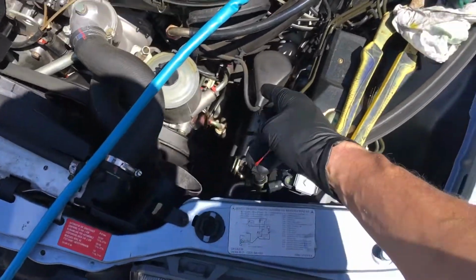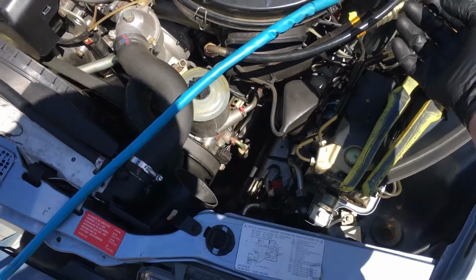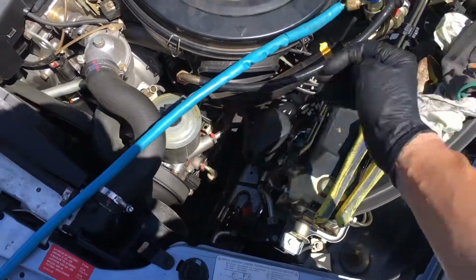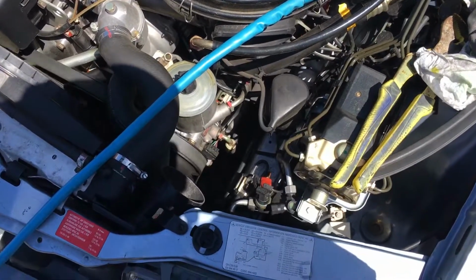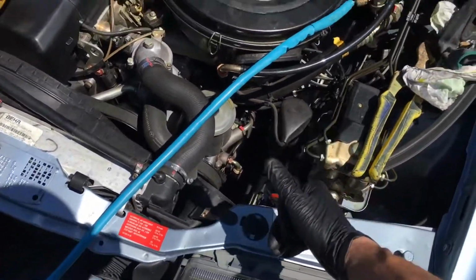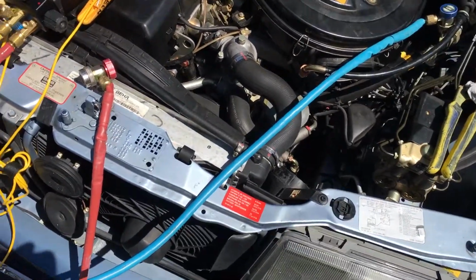Another thing, overheating the compressor with a low charge, by not having subcooling and superheat coming back, and refrigerant to cool off the compressor, lack of lubricant coming back, and an overheating compressor, making seals fail in a short lifetime. Or making them fail due to lack of lubricant, not high pressure, but overheating, due to a low refrigerant charge.